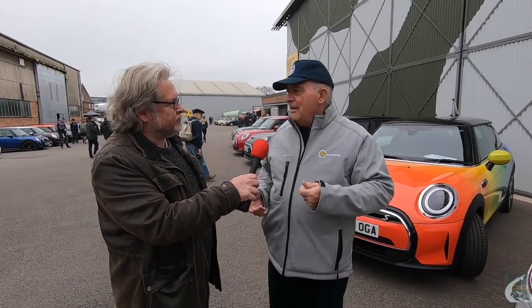Andrew did it last year as well — last year was the first electric Mini to go up the hill. It's great fun as long as you have the traction turned off. It can bog down when it feels the wheel spin — it's a bit muddy and gravelly at the bottom, and the traction control will kill the power if left on. So you turn the traction control off and then it just goes up fine even if it wheel spins.